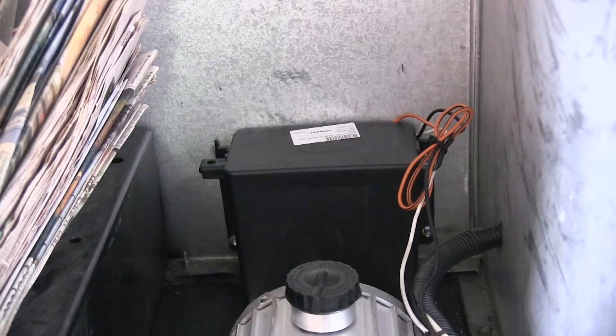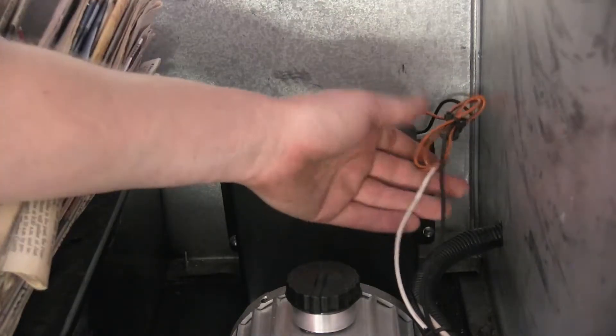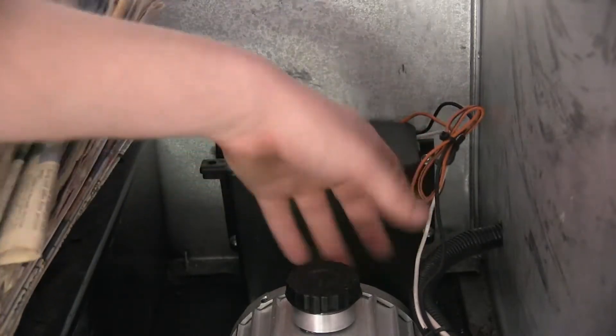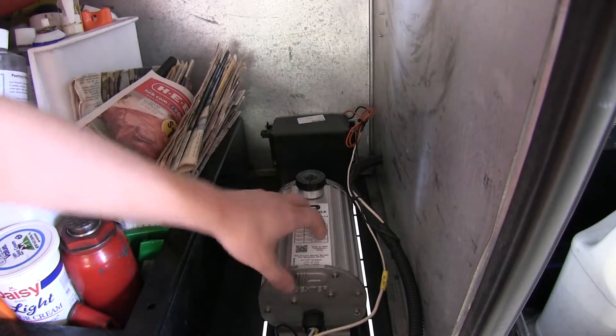The included battery and charger box is a top load, so we can remove our battery if need be. Your breakaway switch will connect to your battery here, and this will also connect to your braking system. This way if you have a disconnect event, you have a power source on your trailer that can apply the brakes.